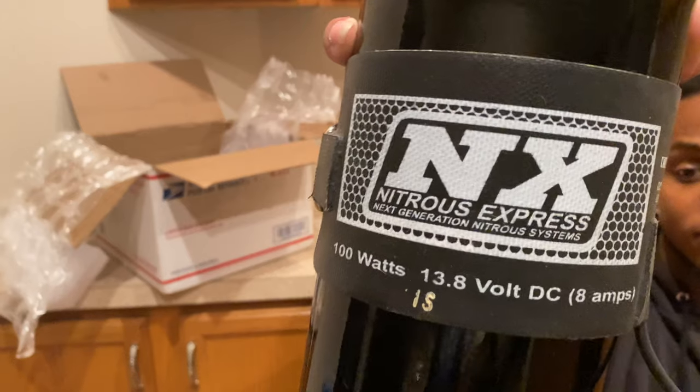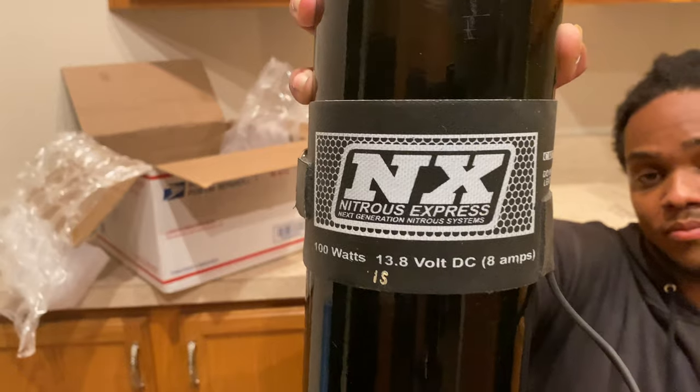So what now can you do to make that bike faster at this point? Now is the time for power adders. You still have a stock motor that's running as efficiently as it possibly can at this point. The cheapest and easiest power adder to add is nitrous oxide. Nitrous oxide has more molecules of oxygen in it than ambient air. So when you spray, it's just like forced induction, but through a pressurized bottle, so to speak.